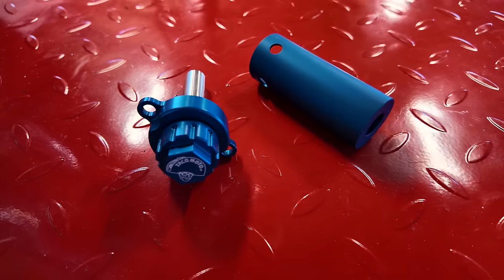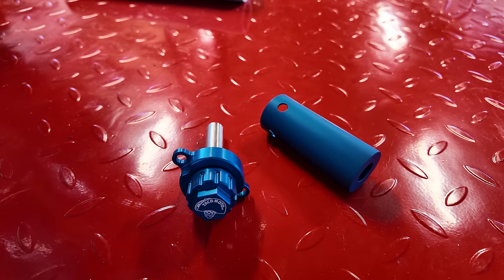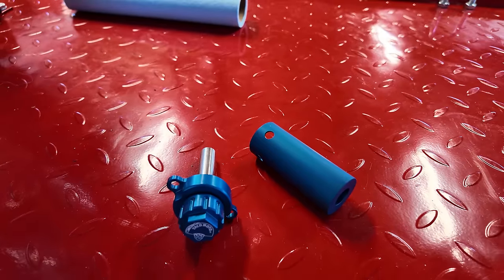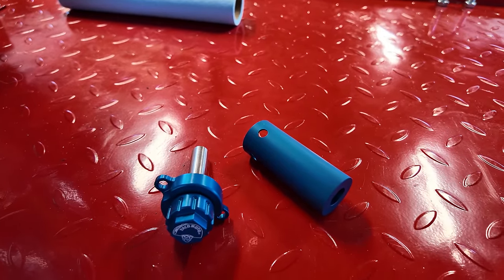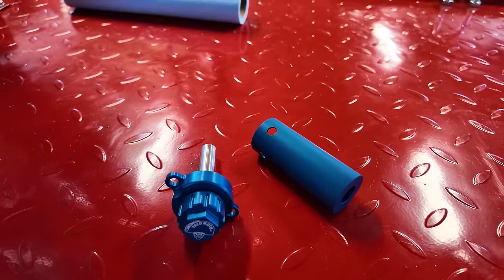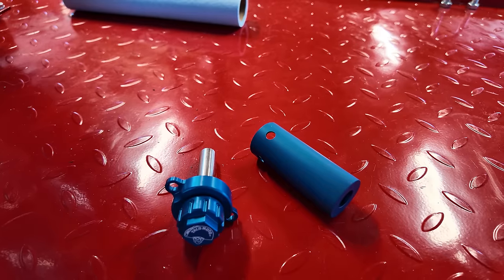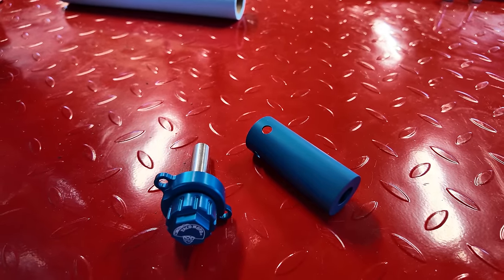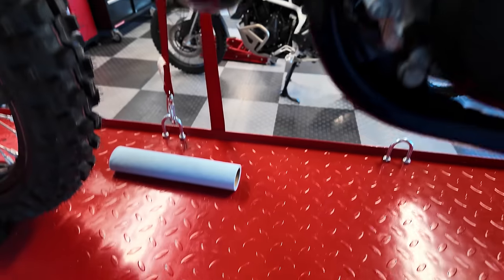All right, I wanted to talk a little bit more as I put this oil filter in. So I'm on the Takamoto website, so I get this stuff right. Basically, what are the benefits of this versus a paper or a stainless filter you might be familiar with? The magnetic filter can filter oil at a submicron level, less than 1 micron. Traditional paper options filter about 15 microns, and stainless is about 30 microns. So by my math, that's 15 times better, a much finer particle that it can filter. Also, there's no flow restriction.